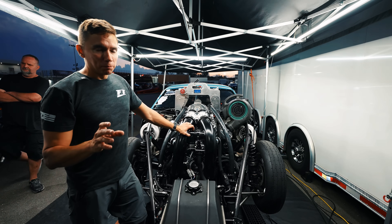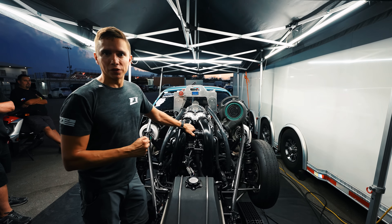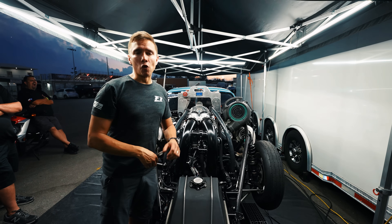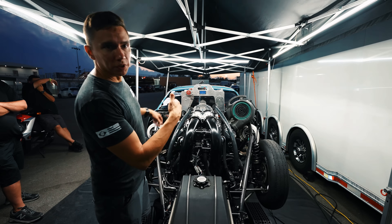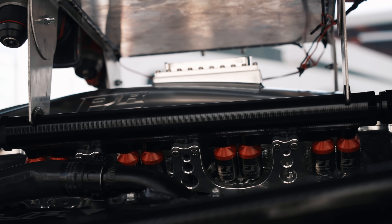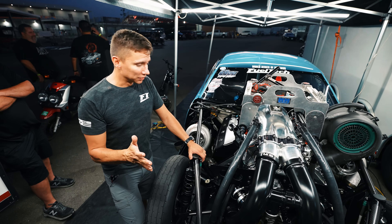Max boost will be limited by your turbo, so pick these details carefully. The turbo size — and that includes exhaust — has to match your engine. You cannot try to run a bad-ass motor like that with twin 45s, that won't work. And more likely, this is not enough engine to run twin 140s either. But you can pretty much run 88s, 94s, 98s, 102s. Then you're going to need to work around other stuff — camshaft, engine displacement, stroke, turbine housing. On the intake side, injectors follow the same logic. This car runs 16 injectors; the amount of injectors relates to the amount of power you make. This beauty right here makes 5,000-plus horsepower.